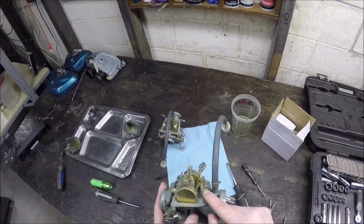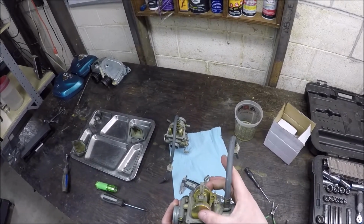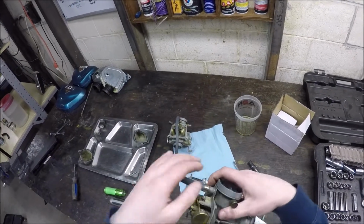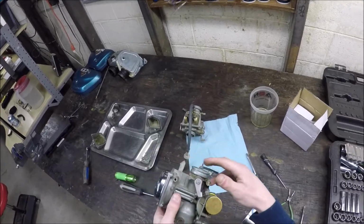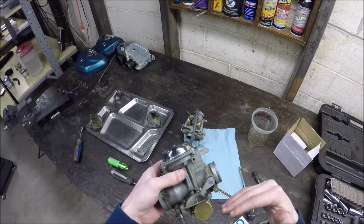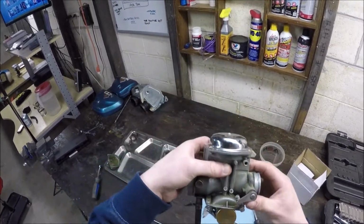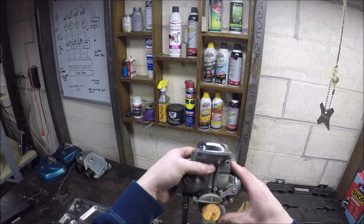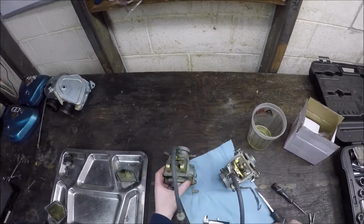is that this pin could be getting stuck, and then all of a sudden the floats don't move. I don't think that's the issue. This float moves just fine. Or it could be adjusted too far out of spec in that the level of the fuel needs to be too high before it seats, and that's kind of what I'm going to be checking. But if I'm watching the needle when it's straight up and down, the needle action is fine. So let's measure the good one.